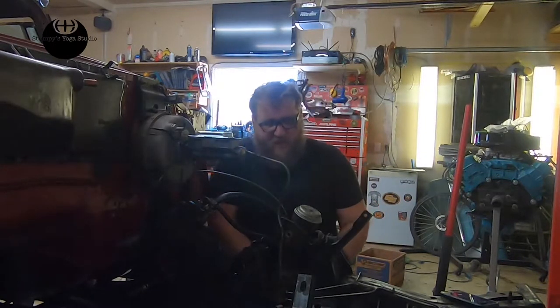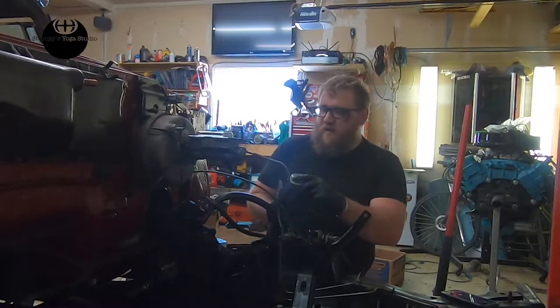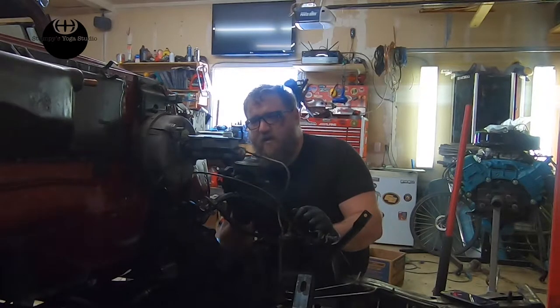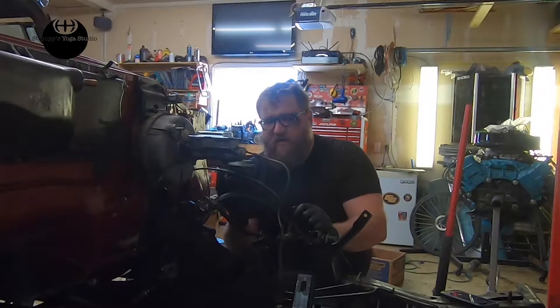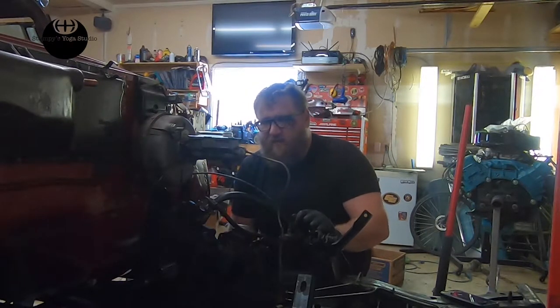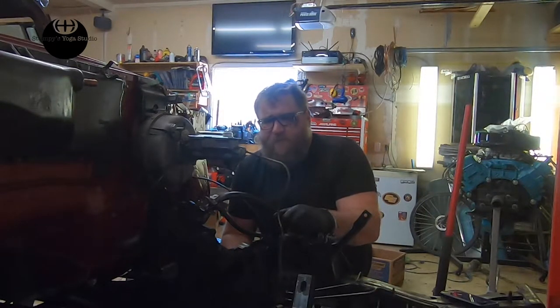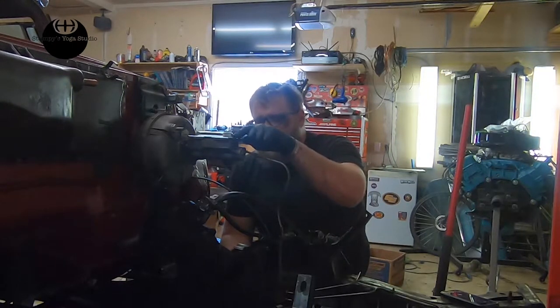And the problem with this is if you have a fault here, let's say this has a leak or something, and there's an issue, then you have no brakes. You've lost all your brakes. If this has an issue, there's a possibility you still have half your brakes. So this is why they went to this. They went to this in 1967 with Chrysler, obviously Chevy, Ford, different years, but I'd say by at least 70, this was probably standard procedure.